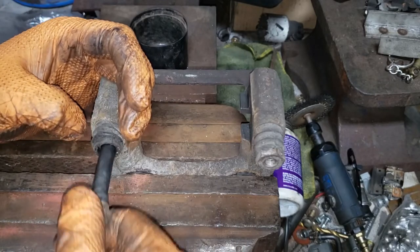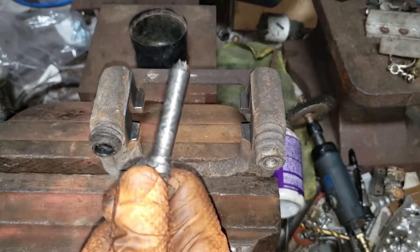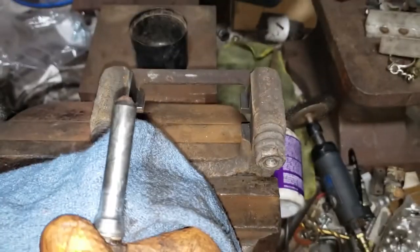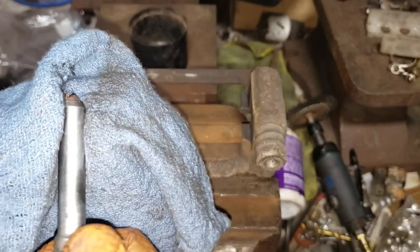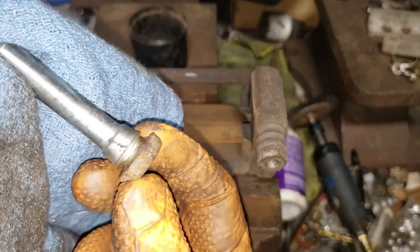If you have serviced it in the way or manner that I have serviced my brakes from my past videos, you should have a slider that comes out relatively easy. Now, that's not always the case, but in most cases, it's nice and lubricated like this and doesn't give you a headache. What you want to do is just clean off all the excess grease and make way for new grease. Make sure that there is no rust.